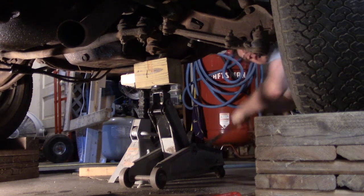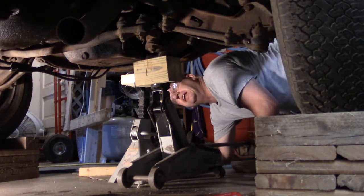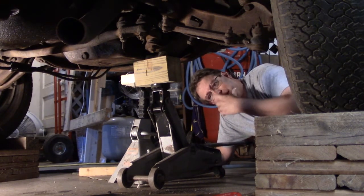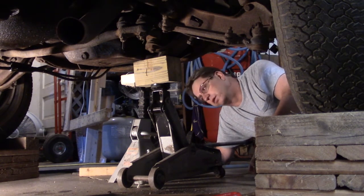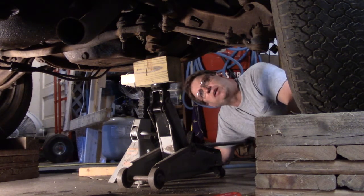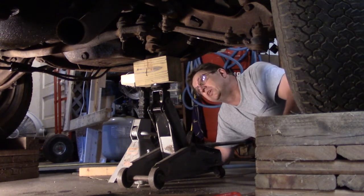So I'm just going to get ready to cut that frame out. The torsion bar should come out with the frame, and then when I'm out in the yard, I can pound them out of there, or maybe I'll be able to get them out when I've got more room. So right now I'm going to put it up on jack stands to get both wheels off the ground.